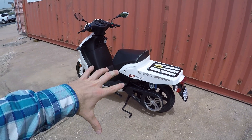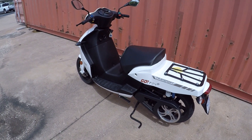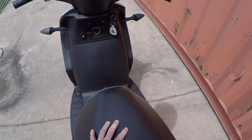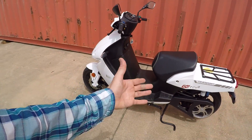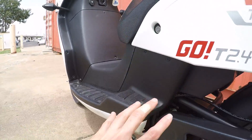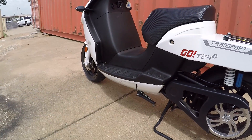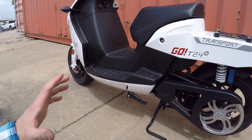This is a high-quality electric scooter. I actually used this to take my motorcycle safety course. Just the weight on this — it's about 265 pounds, as opposed to 400-plus on gas-powered motorcycles and even some other electric scooters. That's significantly lighter because of the lithium ion batteries, which are positioned fairly low and centered. It's a 72-volt, about 40 amp-hour setup, so you're getting a lot of capacity.